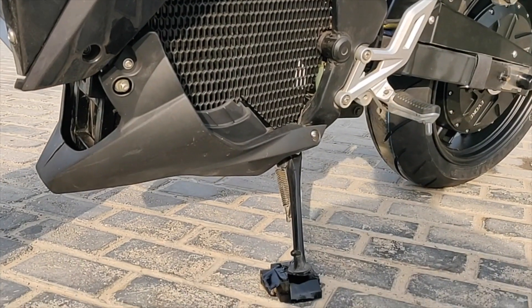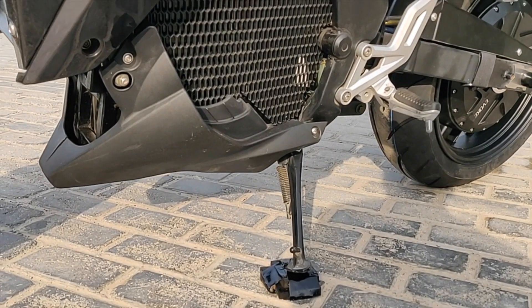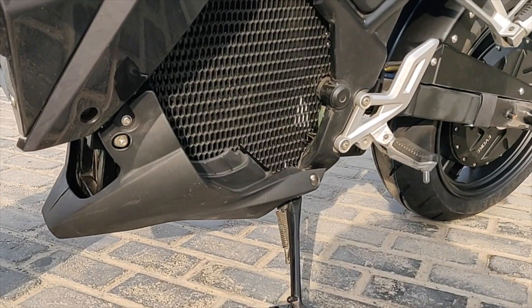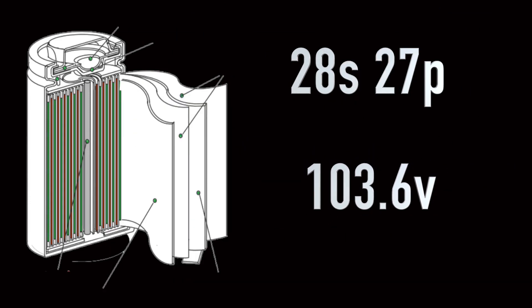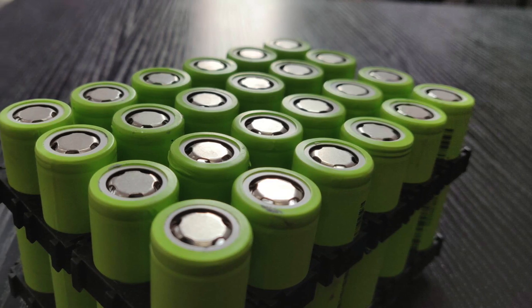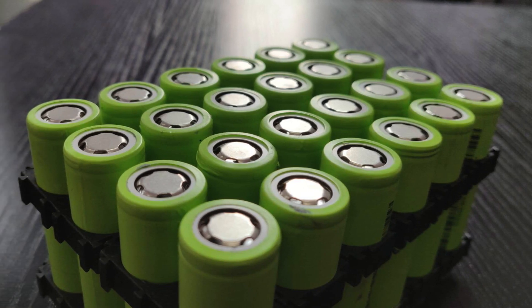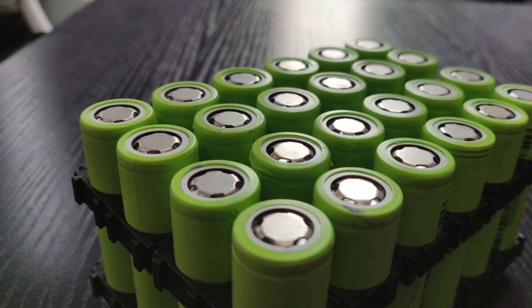The Evoke Urban series features a 7.8 kWh battery capacity. This is a battery configuration of 28S27P, from a nominal pack voltage of 103.6 volts, with a max string voltage of 4.125 volts, all derived from a lithium-ion NMC811 18650 cell.